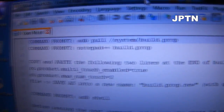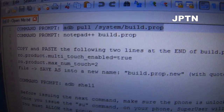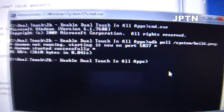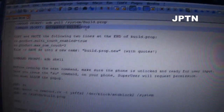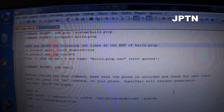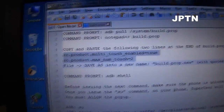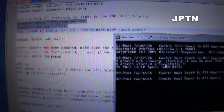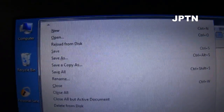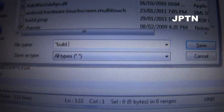The first command in Command Prompt is going to copy a file from the phone. Copy it, go into Command Prompt, right-click to paste, and hit Enter. It's going to start up the terminal shell and connect to your phone. Next, I've included Notepad++ because it's a better text editor — copy that command, right-click to paste, and it's going to open up the file you just copied from your phone. Copy and paste the next two lines into that file, go to the bottom and paste, then go File, Save As, and in quotes type build.prop.new. Save it and close it.